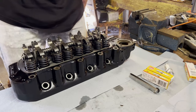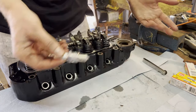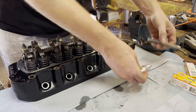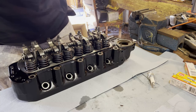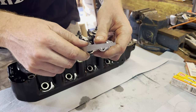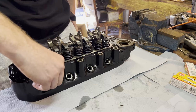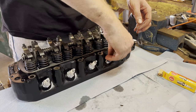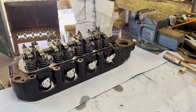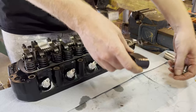Now for this final trick — I know it's purely for show because we're going to remove these afterwards once we adjust the clearances of the valves. These have to be gapped at 0.85mm. Can you see that? Tight and healthy — so these are already gapped correctly. Again, this is just for show. I want to see how this looks and I believe you guys will want to too. There we have it. I also did this bracket — I painted it black, as you can see. Once you go black, you never go back.